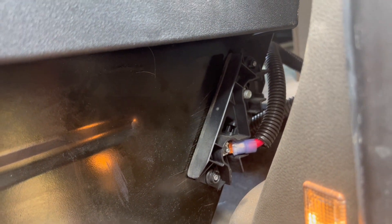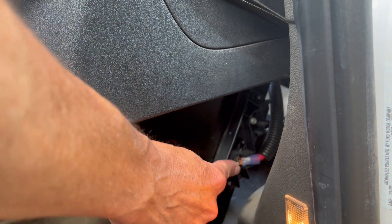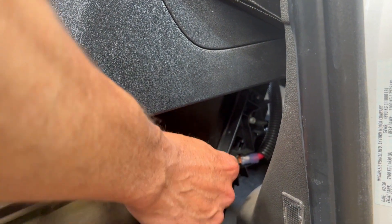In this particular application, there's two. The smaller post is your consumer connection point one — it's rated for 60 amps and it's constant 12 volts.